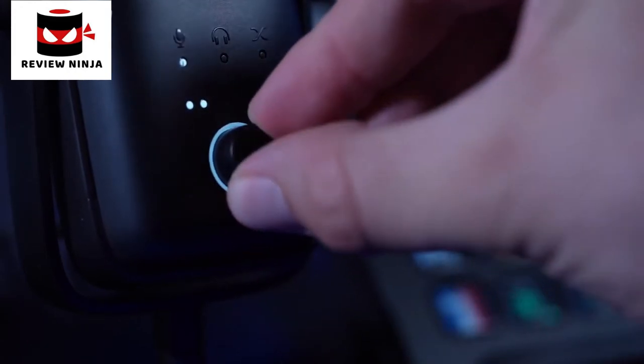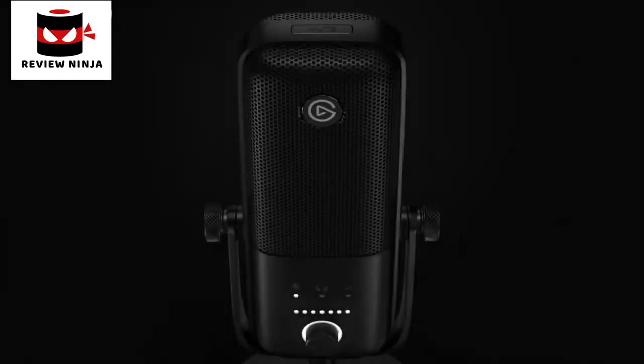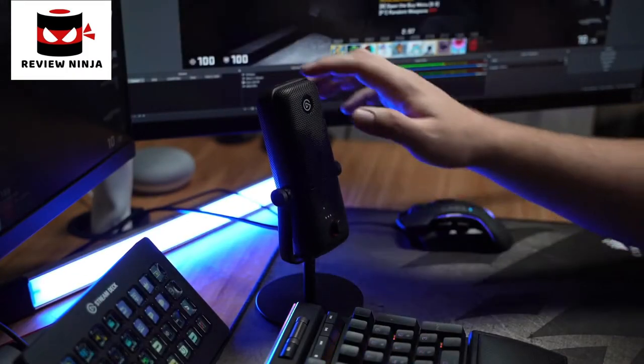and your microphone-PC monitor mix — in other words, the balance between hearing your zero-latency mic monitoring and the audio coming out of your PC. You cycle between these different controls by pressing in the dial. But if pressing the dial changes its function, how do you mute the Wave 3? Another difference is that the Wave 3 is equipped with a capacitive mute button at the top of the microphone. So if you have to mute your stream, you can simply lightly touch the button. This helps prevent noise when muting and is also good for creatives who might have their hands full but still want to mute their mic.